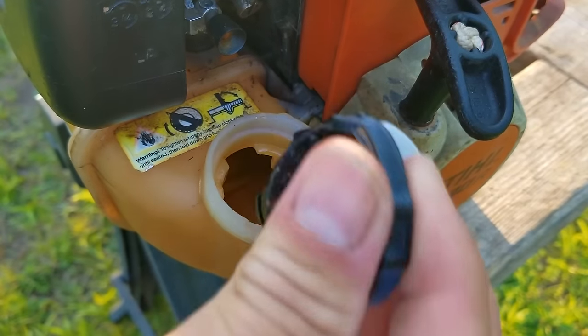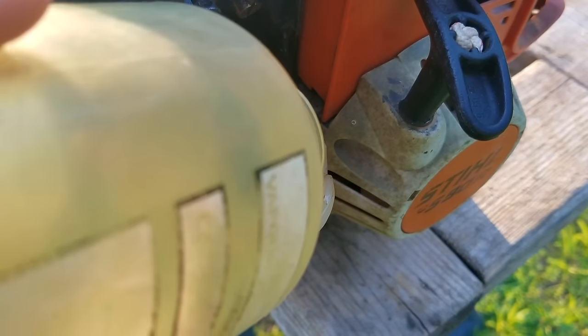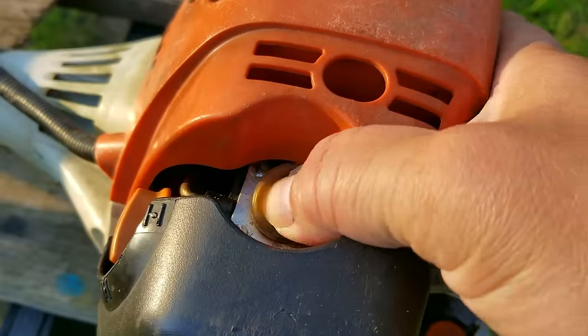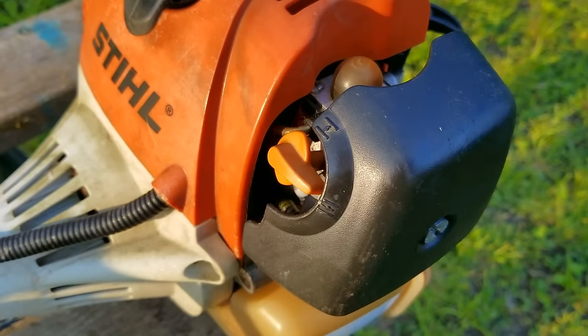The first thing I looked at was their fuel, and I'm glad to say it didn't have any water in it, nor was it stale. I did empty most of it out, so I'm going to have to put some of my own fuel in it to test it. When pressing the purge bulb, it was filling up with fuel, but even though it's working, it doesn't mean there isn't an issue with the carb. Next I'll try and start it and show you what it's doing.